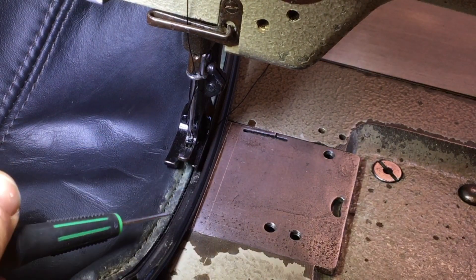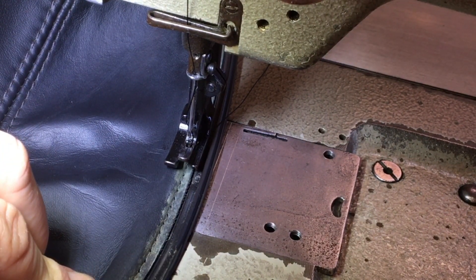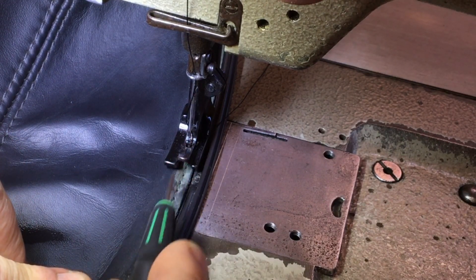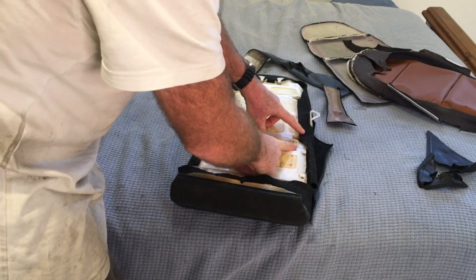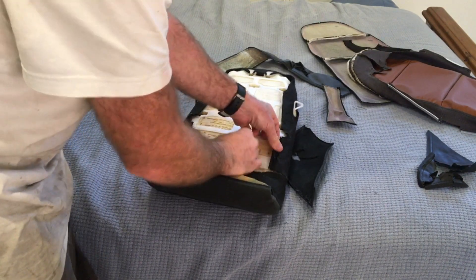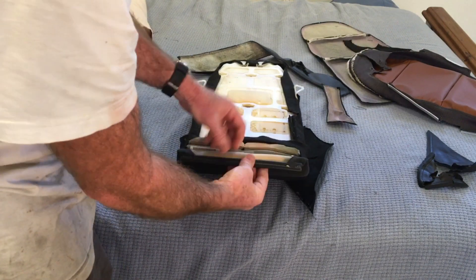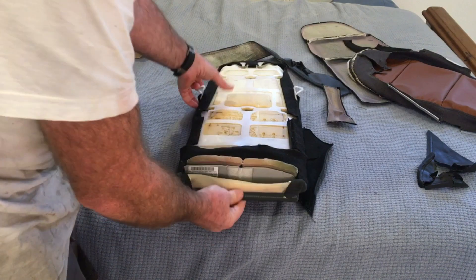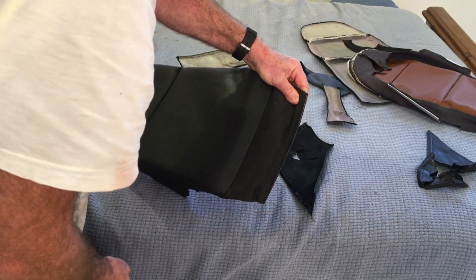Here's a close-up of the sewing concept for all these strips. The right-hand side of the foot runs along the edge of the barb. There's a line in the plastic that the fabric lines up with, and with the foot there the needle just lines up with the thread — that's a very accurate position for all the plastic strips. The seat center just has plain plastic strips on the bottom; with the correct shape of felt you just put it over the top, line up, and sew it down. The bottom strip is doubled over just to hold everything nicely.